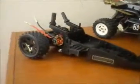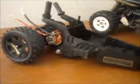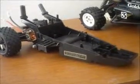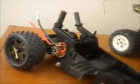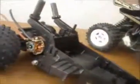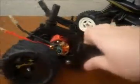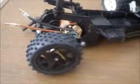The idea is to build a buggy with a very specific motor and put hobby-grade RC electronics in it, with modern 2.2 tires to handle the increased performance. The motor is a Trinity Epic ball bearing 27-turn stock motor — it's called an X Stock. It's a fairly nice motor, though discontinued. I believe the part number is 1167. They sometimes sell brand new on eBay but they're a little rare.